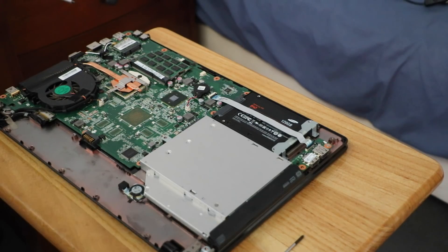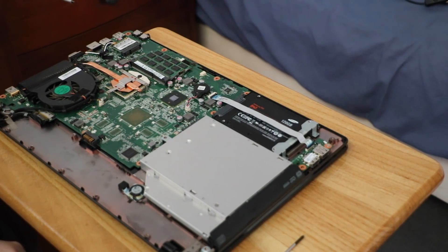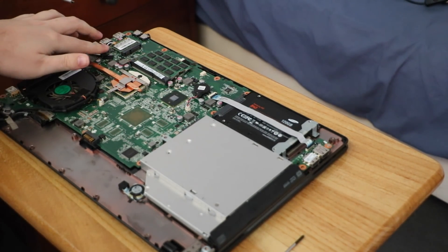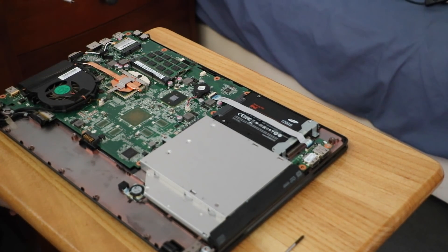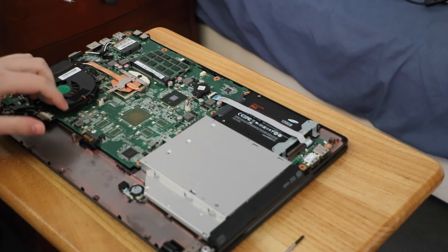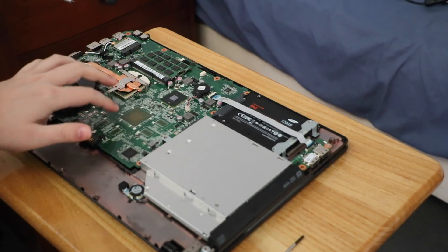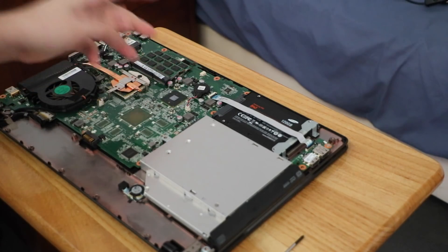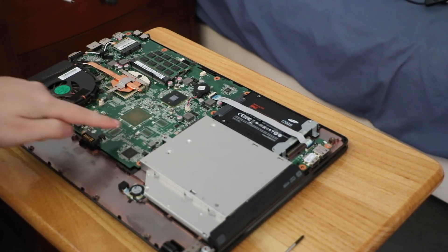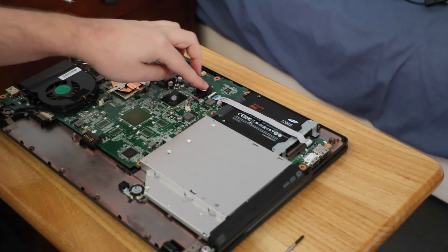So we're actually removing an SSD over here. The optical drive's a bit loose without the cover in. And there's the little wireless card — Wi-Fi — over here. I've got a background in Macs, typically. Thankfully, PCs aren't much different. This model was a rather low-end model — it's missing the dedicated graphics, so it's only got the integrated Intel graphics. There are spaces here for VRAM and a GPU, but more heatsink would have just come around. There's also your date-time battery over here.